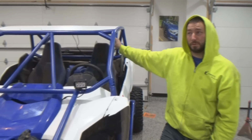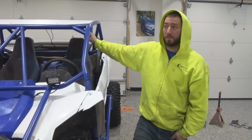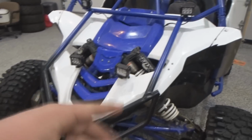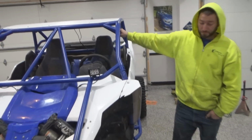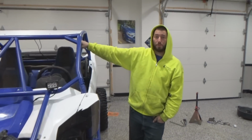So it'd be like 2.5. It's 3 inches, something like that. No, it's still 2 inches lock to lock. Oh, it's just the way the gearing is in the portal, it turns further but the same amount. So there is one that's got a little bit more throw. A half inch out of 3 inches is a pretty significant amount. Yeah, that's a solid percentage when you look at it that way.